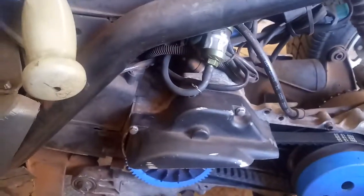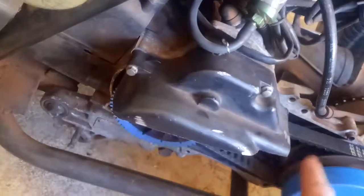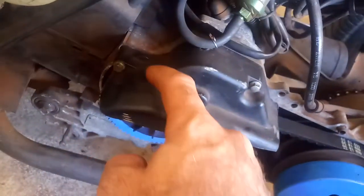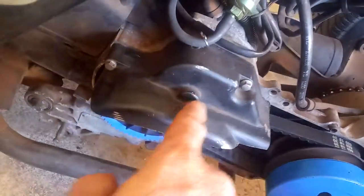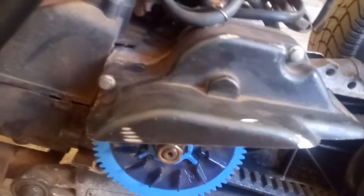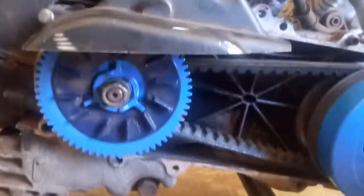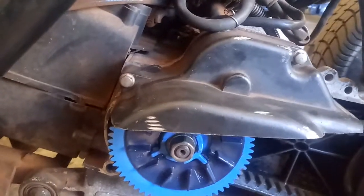I mean, I have to clean it up a bit, but basically I have taken apart the crankcase and cut off the top of it. With just this setup, it makes it easy to see how your CVT is shifting, and be able to tune it properly.